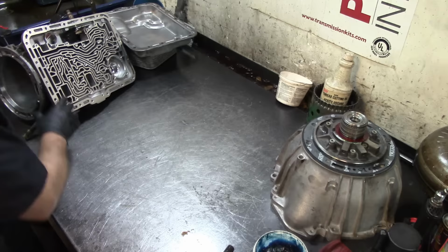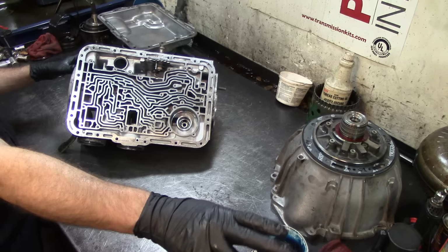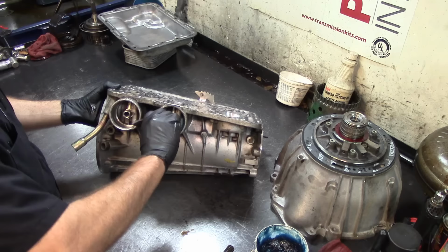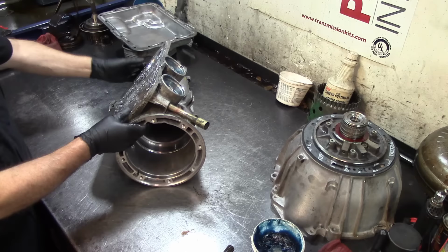Now let's go ahead and assemble everything inside the barrel of the case so we can get this thing done. I know I got stuff over there on that bench, because that's where I built the drums and stuff. And this one, I don't hang it because it doesn't have provisions to hang it. But we're going to use an old Chrysler case that I got. I got two of them, actually three, that I use for building transmissions that I cannot hang. Now you could hang it somehow, but it's a small unit, so it doesn't need to be hung.